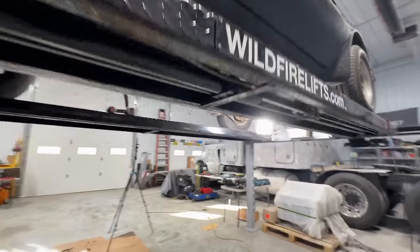That's just filled with bondo — this is pretty common to rust out. Think of it — this car is 40, 45 years old. If it was driven in the winter in Alberta, they salt the roads up here and the salt and sand just gets caught up behind there and rots it out. I'm not surprised that it's a little rotten. How's the other side look? Yeah that is bad — more solid I guess. That side is definitely going to require a little bit of cutting and welding for sure.